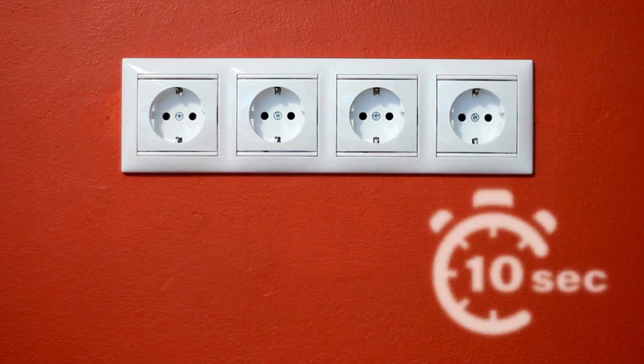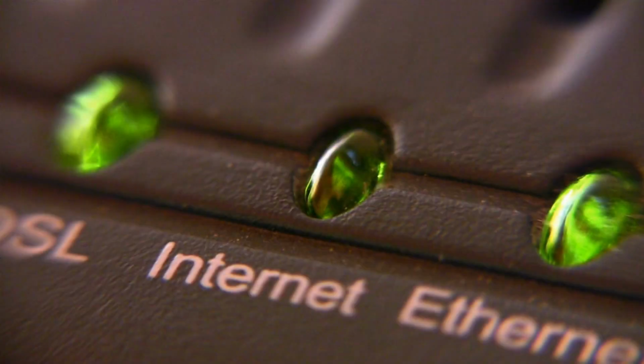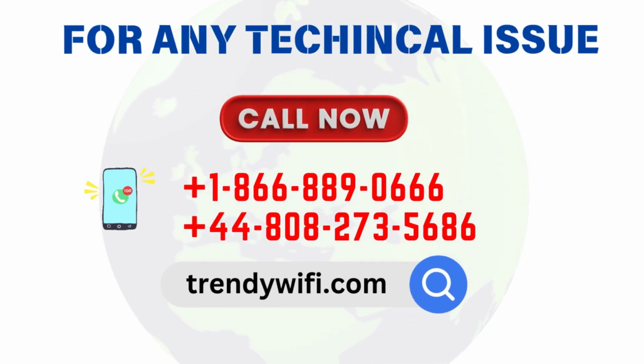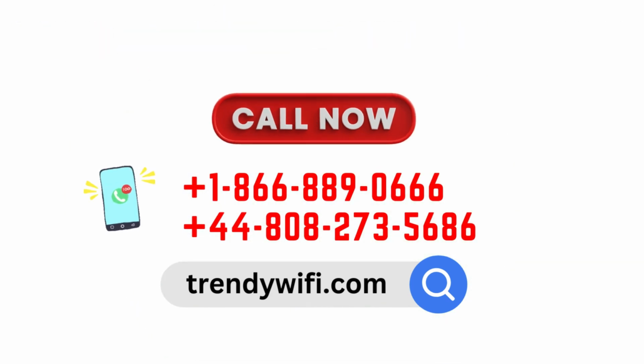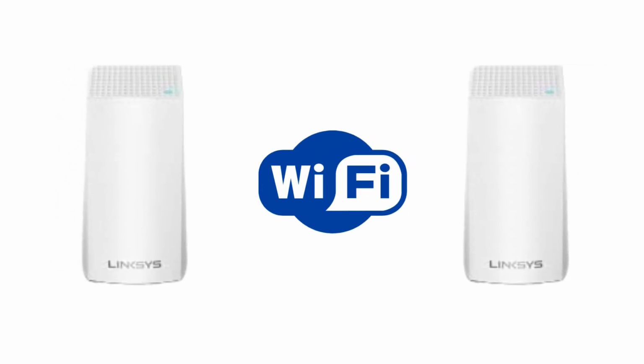Unplug the node, wait 10 seconds, and plug it back in. Confirm that your modem has an active internet connection. Relocate the node closer to the main router to ensure strong signal.